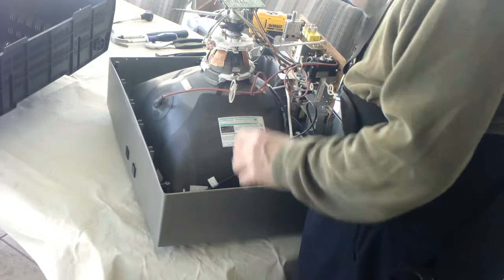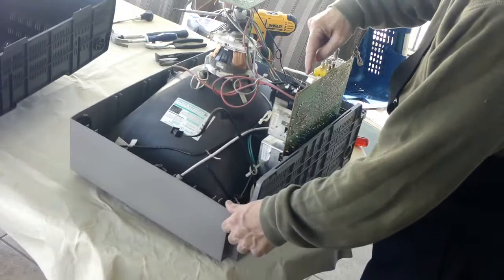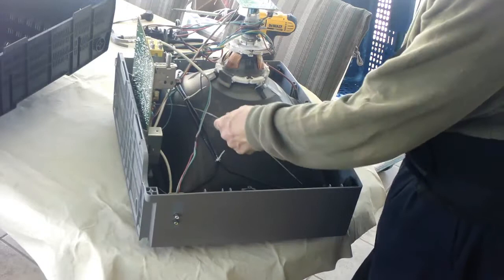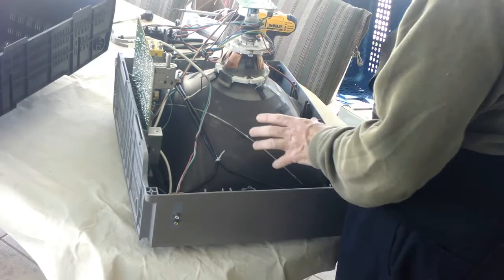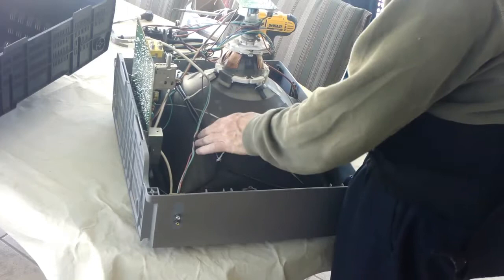You've got a couple of different ways. There's a discharge line that feeds through a resistor, as well as one that comes back from the yoke, which in turn bleeds into this ground strap. Now, this tube — you can see the color here — is painted with an electrically conductive paint so that it can absorb static electricity and discharge it through this line. It also has some copper wiring that helps dissipate electromagnetic fields that build up.